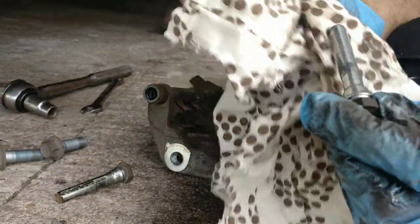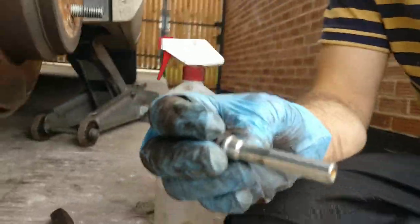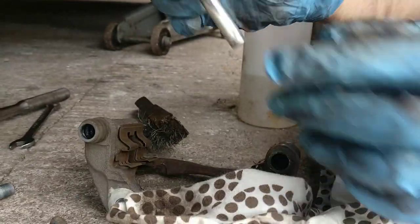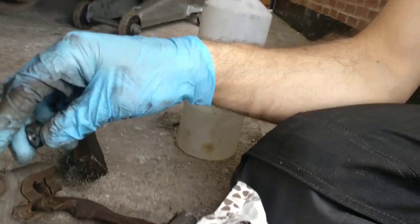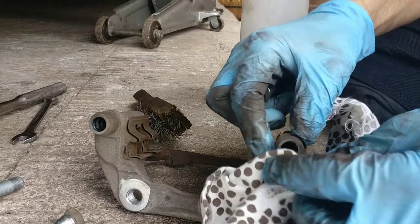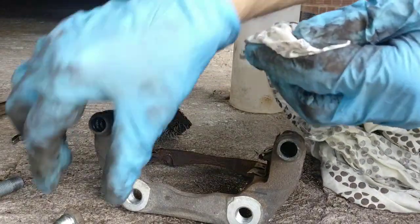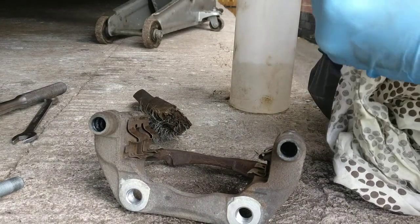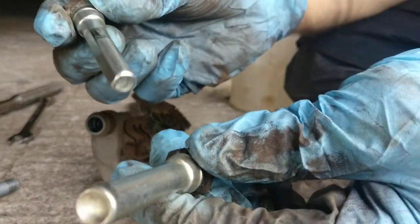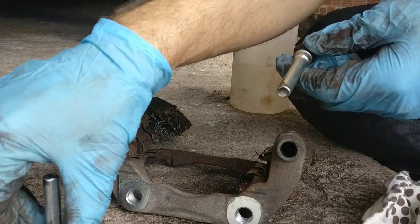Mostly when you're replacing brake parts, it doesn't matter front or rear, always look at them ones because it's easy to neglect and not to check it. But on the front ones, one of these pins, it was sliding, but it was quite stiff. Okay, pins are different, this pin from this one side, this from there.